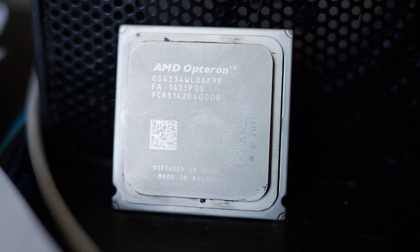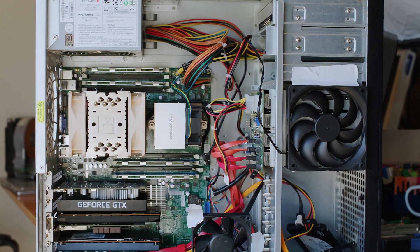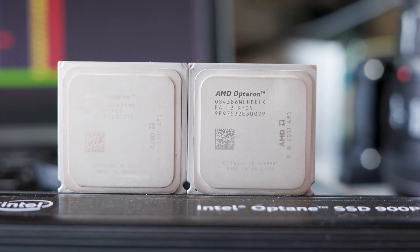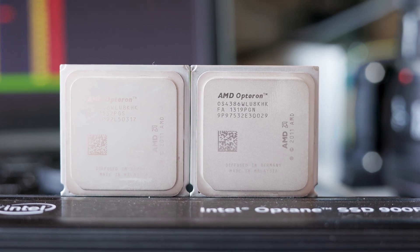These were actually very similar to the desktop CPUs, but had a few more features enabled like being able to use registered DDR memory and being able to use a dual-socket system like this one. But unlike the desktop processors, these are a bit more optimized for low power, so they are clocked at lower speeds to keep the heat and power consumption down. The system came with a single AMD Opteron 4334 processor, which is a six-core processor.